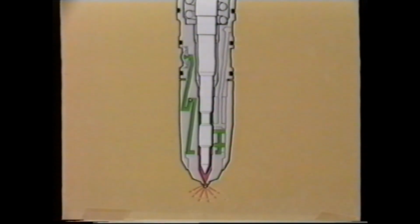When the injectors are adjusted correctly, during the injector stroke, the plunger just contacts the injector cup at the end of injection, and to ensure that all the fuel is expelled from the injector, the camshaft is designed to load the injector plunger for a short period to squeeze out any fuel that may be remaining. This is known as cam nose crush.